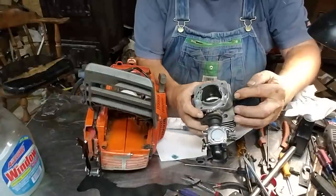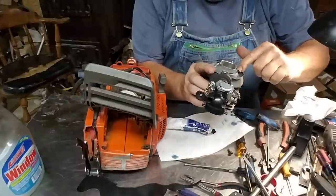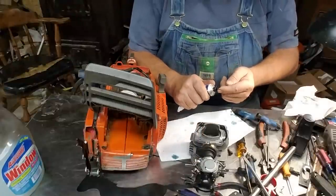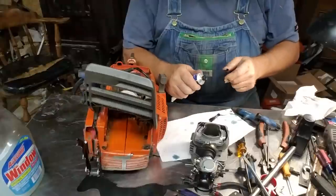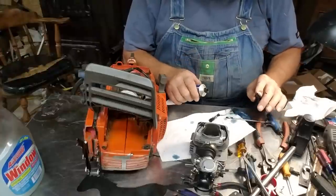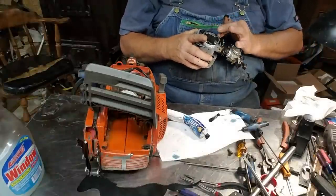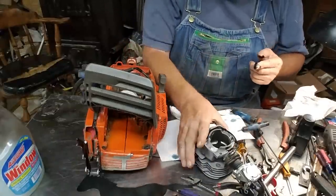A little bit on my finger, and I just paint that on. Thin film, you don't need very much. And for those of you that missed it, I use motorcycle engine assembly silicone. That's what I use. This is the problem with having a tube around for a long time. I don't know how many saws you can run. They actually get where they get hard. Rather than use it up, it just gets hard.